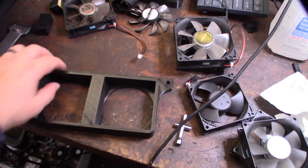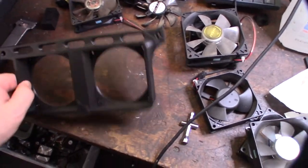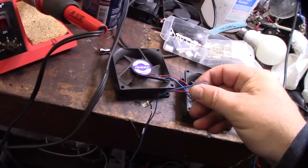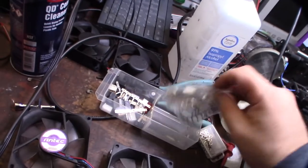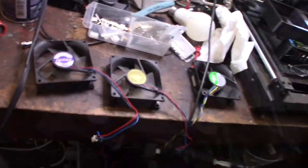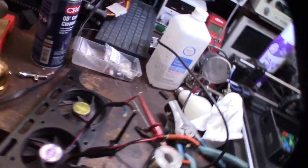I took the design from the top rail — it looks almost identical, I'll show you that in a second. These fans aren't wired right for the motherboard, so I'm going to cut them, splice them, and redo the connectors — I always keep extra connectors and pins. I have the two fans wired in parallel and they're going into the same motherboard connection.